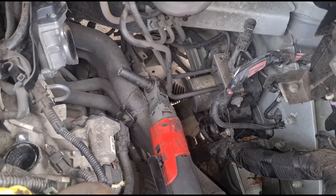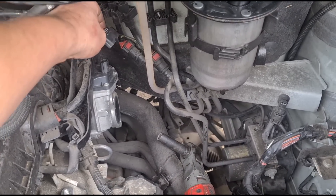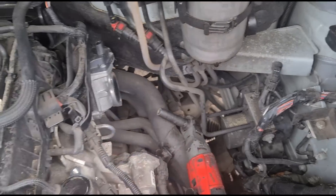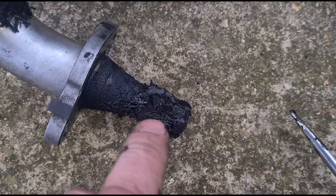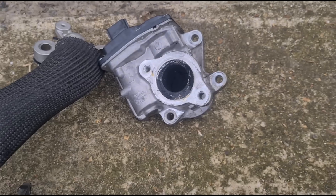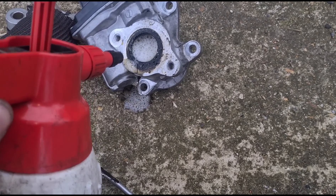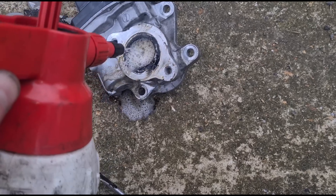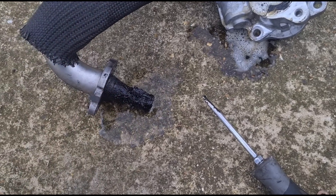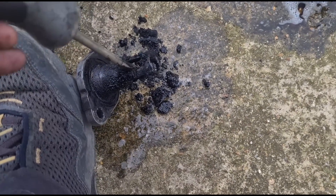So we're going to get the complete EGR out. We're just going to disconnect it from the electrical plug there. We'll get these bolts out — I think it's got a couple of 10 millimeters there. We're going to need to clear out these airways and the actual EGR valve itself. We've got some DPF cleaner in a pressurized bottle here and we'll just spray that on — you can see it melts away the soot. We'll let that soak for a minute. It is quite hard, so we're just going to give it a little poke with a screwdriver.